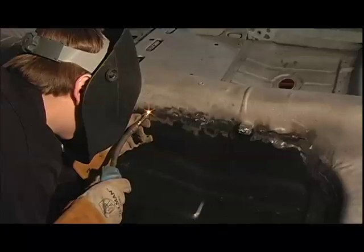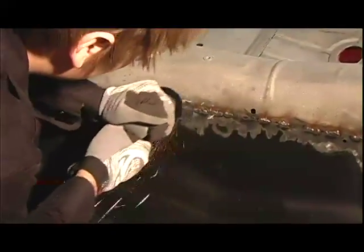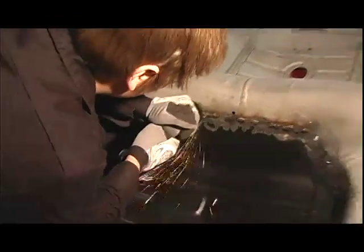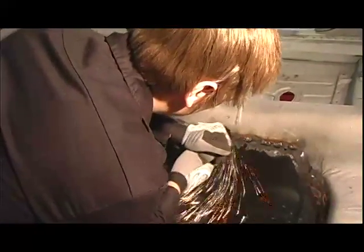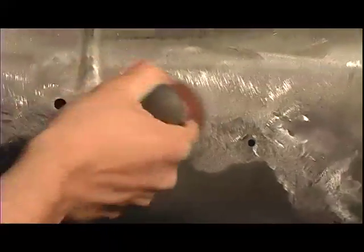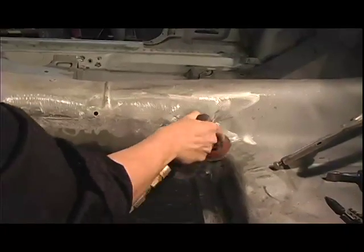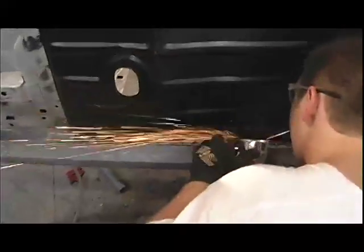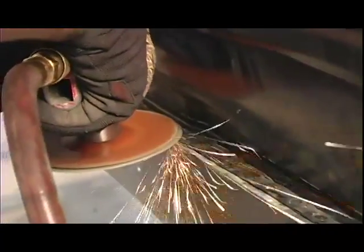We were left with a panel ready for grinding. Now it was time to clean up all those welds. You have to follow a procedure with grinding — you don't want to put too much heat in the metal because it can start to warp and fatigue. You don't want the metal to turn blue as you're grinding. Nick used a roll lock tool with 3M roll lock discs at a fairly abrasive grit, buzzing back and forth to knock down those welds, moving around frequently to keep the heat out of the panel. This had to be done on both sides — inside and on the bottom. Once the welds were ground flat, Nick dressed them with sandpaper on a small DA. Tom used a cutoff wheel to knock down the plug weld high spots in the pinch weld areas, then went through with a sander to knock those flat.